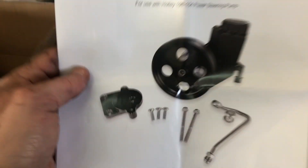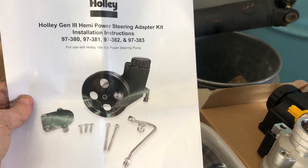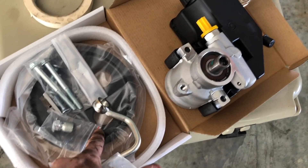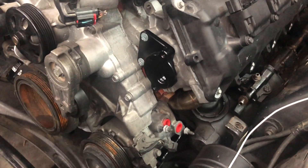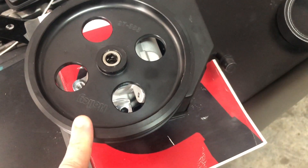This is the kit I'm using. Holley was out but luckily Mancini had a couple — I'll put the exact one I purchased in the description. It's built to work with the old-style boxes because of the pressure. It has a plate that goes on the head to allow mounting. I needed to get the pulley pressed on first, then install everything and measure for a belt. The mounting plate goes where the old pulley went, using countersunk screws, with the pulley pressed on — then we'll try the belt.